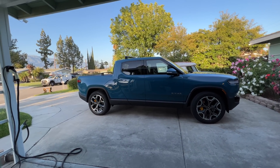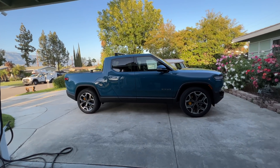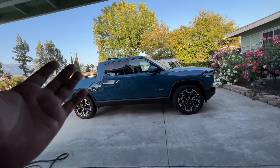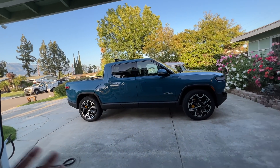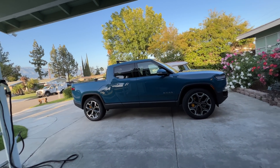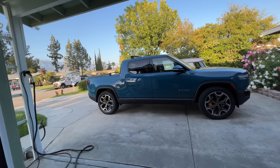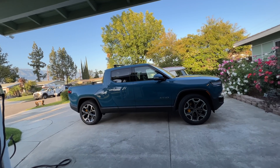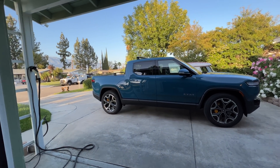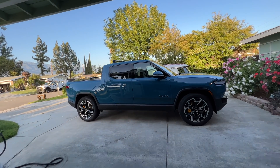By Tuesday, they sent us the service report and we just had to sign for it. Basically all they found was a loose fitting — they hadn't tightened all the brake lines, which is strange, but this is within the first 2,000 cars off the production line. So it wasn't a big deal; just a loose line, which is why it was leaking brake fluid — that's probably what you guys saw in that video. It was a quick, easy fix: they tightened the lines, refilled the system, and bled the lines to remove any air. One hour of service time.